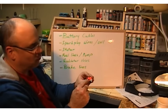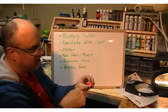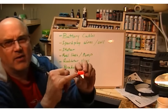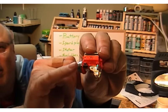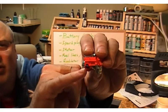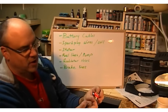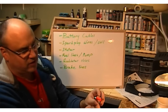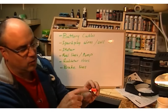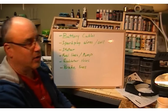Starters are usually on the bottom right-hand side if you're sitting in the driver's seat looking forward at the engine, right back by the flywheel. You can see it has the bigger circle on the bottom and the smaller cylindrical shape on top — the top would be your solenoid, the bottom is your starter. When that gets electricity the solenoid throws out the starter wheel and it runs on the flywheel to start your engine.